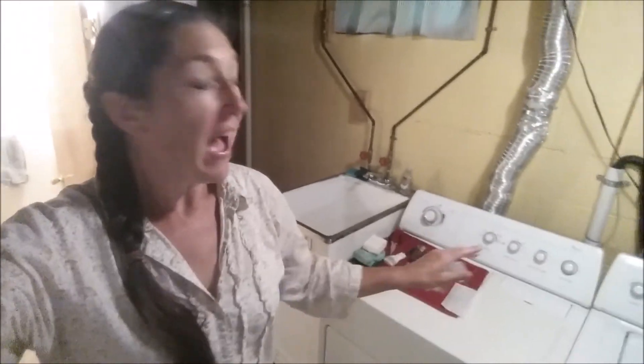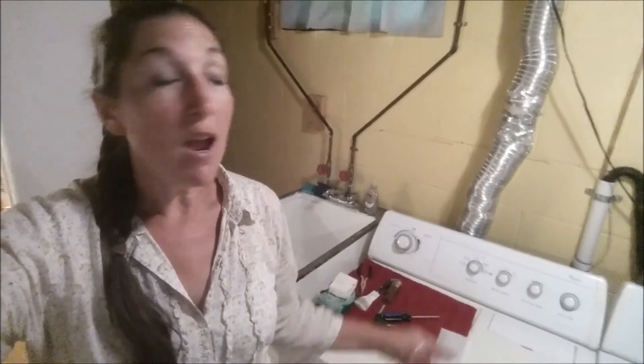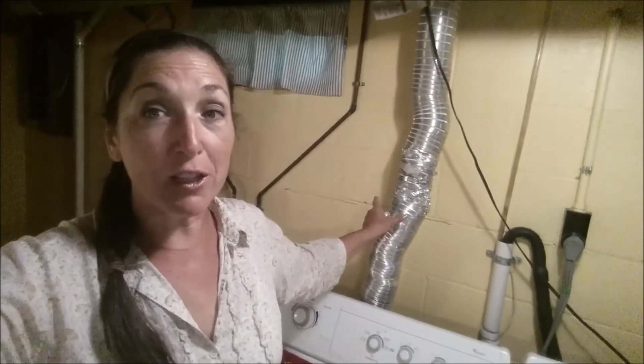This is an older Whirlpool standard washer and dryer set - top loading washer, front loading dryer. I got this washer used for my mom when she had moved up north, and it's been in this house for probably eight to ten years and been virtually maintenance free. The dryer - this is the first time I've ever had an issue with it. For eight dollars I was able to fix this dryer, which was caused by my own stupidity when I pulled everything out to vacuum and shoved it back too far. If you can avoid the soft flexible aluminum dryer vents and go with the rigid duct type, you'll be much better off. You can pick up dryer venting on Amazon, at any supply shop, or any big box store.